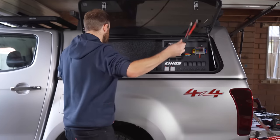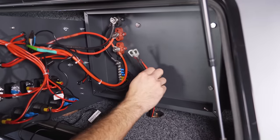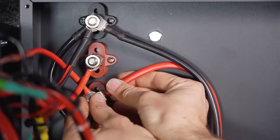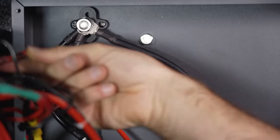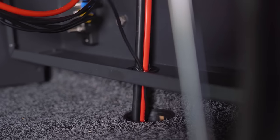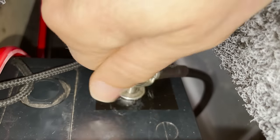I've cut a hole here, so I'm going to feed the two wires with the M10 terminals up through the bottom of this control box and connect them to the earth for the black wire, and the second post connected to the brown wire on the DC charger and to the 12-volt control box itself. After that, I'm just going to run the temperature sensor wire down through the grommet in the control box, through this hole, and over to the negative terminal of the battery.